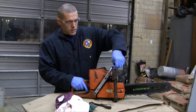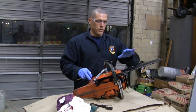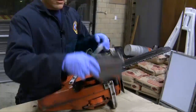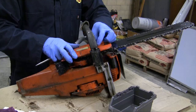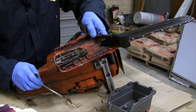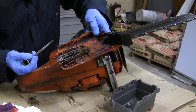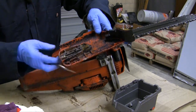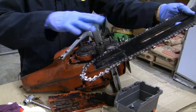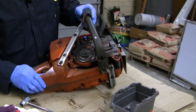The first thing I'm going to do is get rid of the parts I don't want to deal with first. I'll go ahead and take off the bar and chain and the cover. As you can see, it's pretty dirty in there — not unlike how a chainsaw should look, but it's not clean. This saw has been used recently, so this is my chance to clean it up and make sure there's nothing wrong. I'll set the bar and chain aside, leaving it assembled.